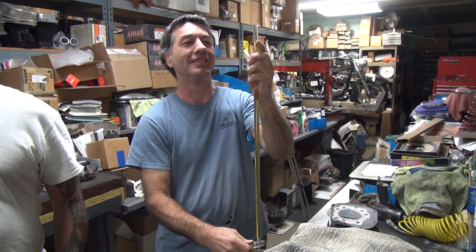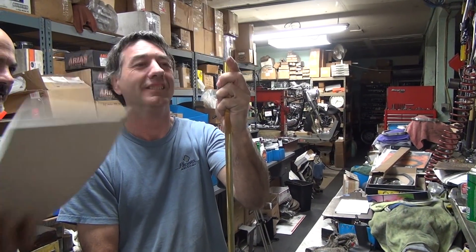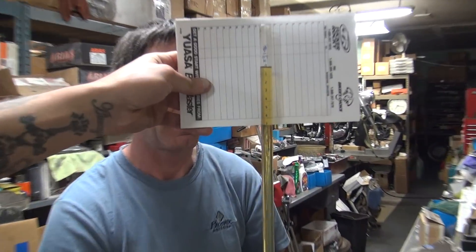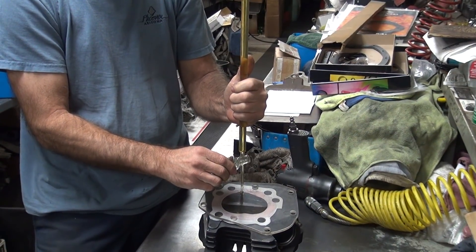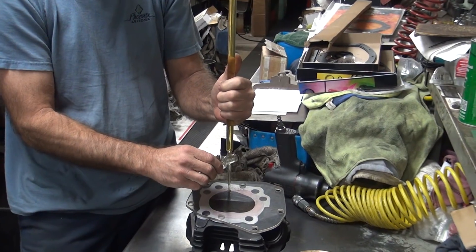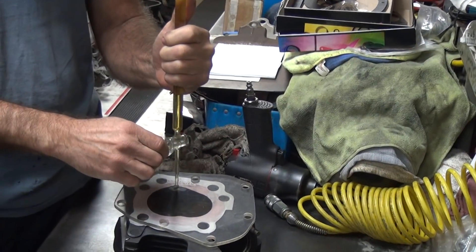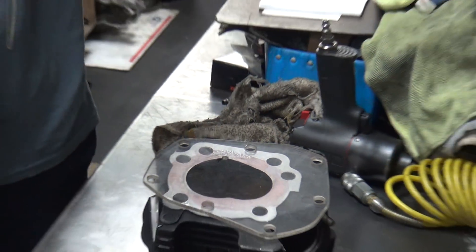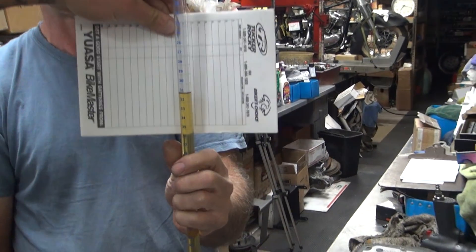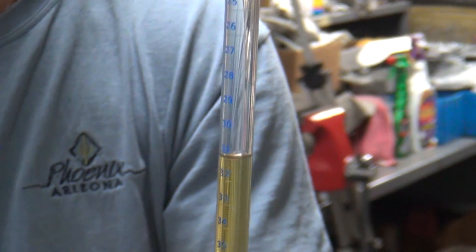Alright, where are we at here? We went five over again. I'm using my finger. It's five over. My finger's still in front of it. It doesn't matter. Okay, we can call that one zero. Yes, zero — give or take the meniscus. I'm pretty sure it's not going to take all of this. I called it at 70 — what do you think? 80. Might as well. I think it's dropping quickly. We're past 70. We're coming up quick though. Okay, what do you got? Looks like it's 31 and change — another extra one or one and a half. To that, I mean it's 81cc's. 31 and a half — 81 and a half cc.